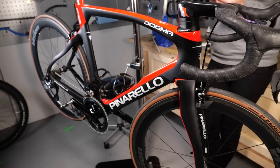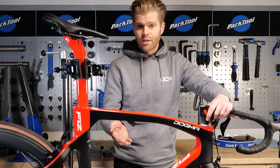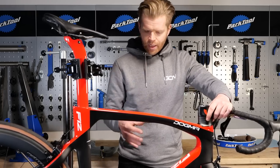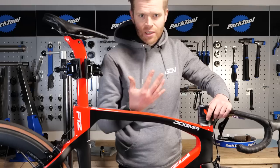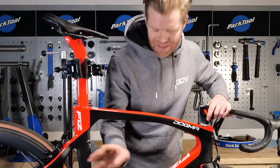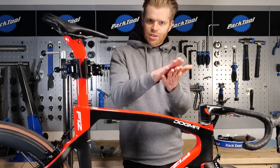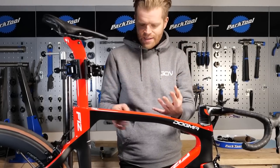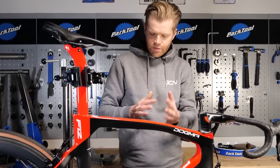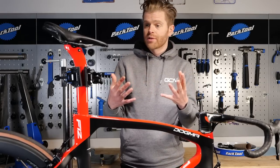Other things such as the chain set and derailleurs, these Shimano ones, they're made of alloy, but they are painted and lacquered, so you can apply a ceramic coat to them. Just be aware that it's pointless doing it on the contact surfaces such as the teeth and things like the cassette, because there's going to be mechanical abrasion on those. That's why the paint actually rubs off on the teeth of your chain set, and a ceramic coat isn't going to do anything there. It's not going to stick on either. But these bigger areas of the chain set and the cranks, yeah, you can help keep those cleaner,